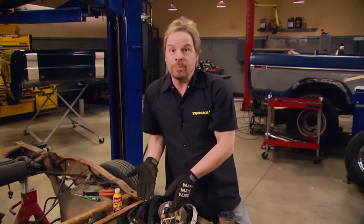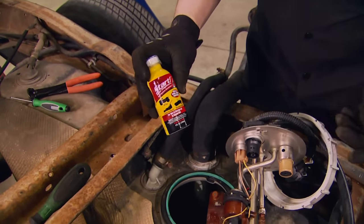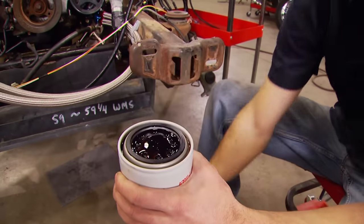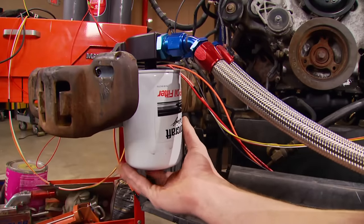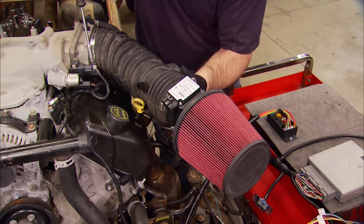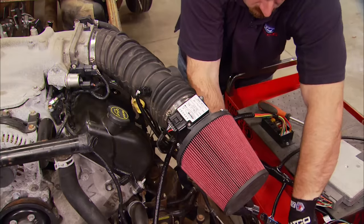Speaking of fuel — we know the fuel in the tank is decent, we put it there and drove around on it, but we don't know about the fuel in the fuel rails of that engine; it could have been sitting for years. So we're going to use some "Start Your Engines," which is designed to stabilize fuel and bring vehicles out of storage — should do a good job on those injectors. Even without a filter relocation kit, it's a good idea to fill the filter up before you install it. Do not get any contamination into the fill hole — it's a direct connection to your engine and will get pumped directly into the oil passages and could damage your bearings. We're reusing the Mercury Marauder inlet tube, loaded with a Pro-M air meter and filter that come with the kit. The rest of the connections are just simple one-way plugs that you can't make a mistake on. With that taken care of, we're just about ready to fire this thing off — it only takes four wires to get it up and running.